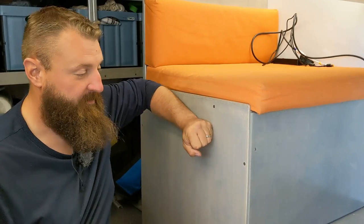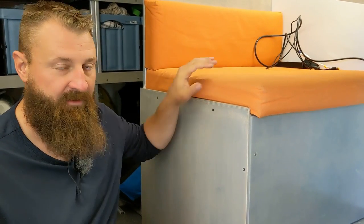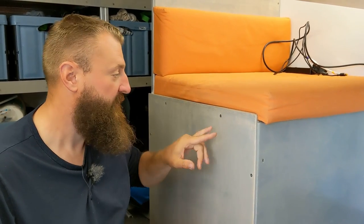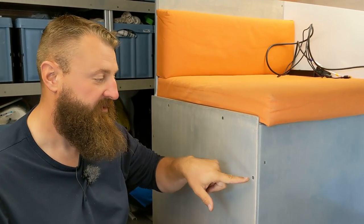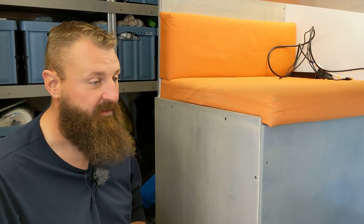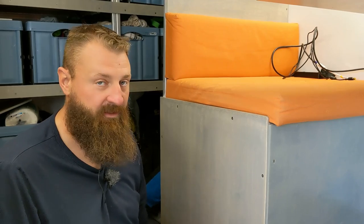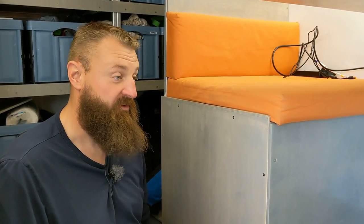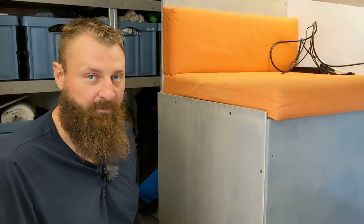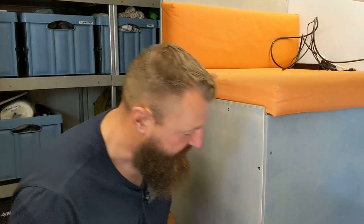It's going right here under this dinette. All of our interior cabinetry has been constructed with one-inch square aluminum tubing, and I've drilled and tapped machine screws into the tubing to hold all the panels on. I did that because I can remove any panel and take it right down to a skeleton for jobs just like this, or if we damage something or the configuration changes. It's all bolted together, so let's take it apart.